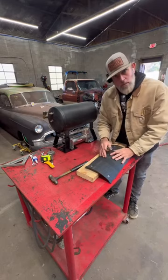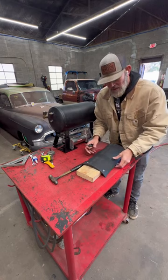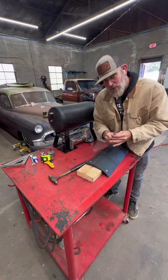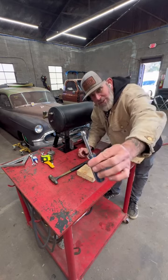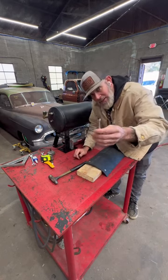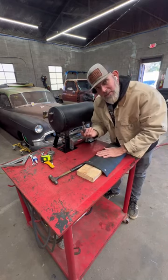I'm going to make this little base here for all this assembly to sit on in the trunk, to help cut down on vibration even more. I need to punch these holes in the rubber, and if you've ever punched holes in rubber before, they actually sell some pretty handy little punches you hammer through. But I just took an old nut driver that you tighten down little things with, put it on the bench grinder, and made myself a little punch.